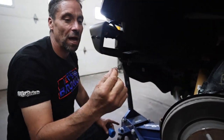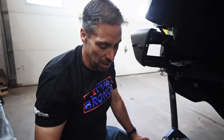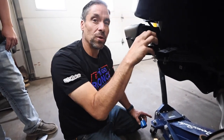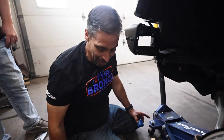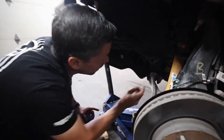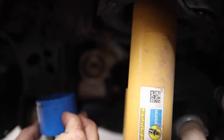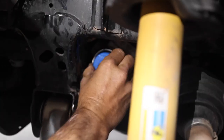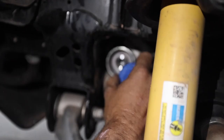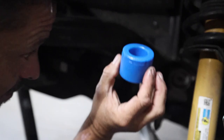I get this question a lot: did I screw it up? I've got a little piece of rubber that came out. No, you did not screw it up. The whole purpose of that O-ring is to give a nice tight fit going in and give it something so it can't back out of that step. Then our final insurance to where that part won't come out is the snap ring. Take your snap ring, put it on the inside there, just set it. The easiest thing to do is take the install tool and push it in — you'll hear it snap. If it's still sitting there loose, you didn't go in far enough, so take your hammer and tap it until it seats.